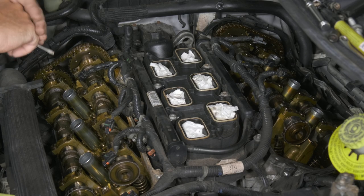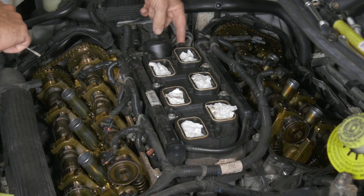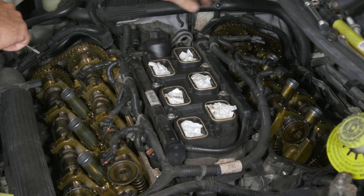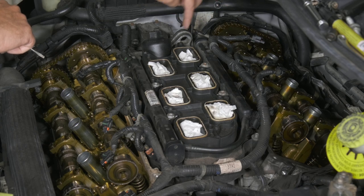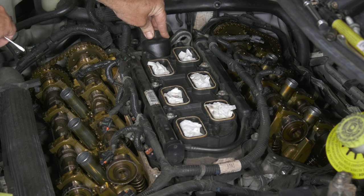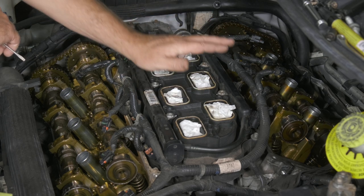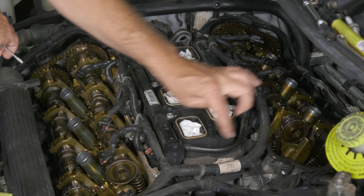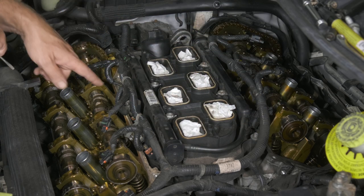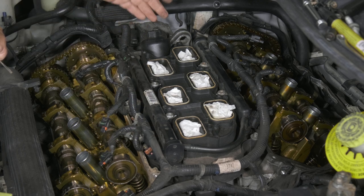With some more inspection, we have our oil filter housing here and when we look down in there we can see a puddle of oil. This is where our oil was leaking off the back of the vehicle. We need to pull the lower intake off to be able to get to that — so we're going to have a couple 8 millimeter bolts. First thing we're going to need to do is unplug all of our injectors and our fuel line and then we'll be able to remove that piece.